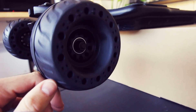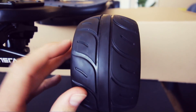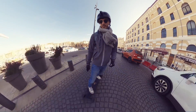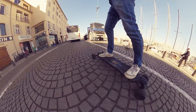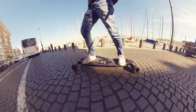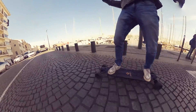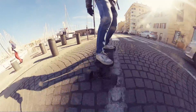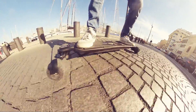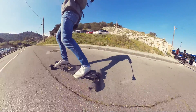The Black Carve 2 comes with 115mm rubber wheels already mounted. These airless wheels are really comfortable on every road, from rough to perfect ones — you definitely won't feel annoying vibration, even on cobblestone. I'd only been using the 120mm cloud wheels before. They are really soft and reduce vibrations, but they have a disadvantage: they drain your battery. At 70A hardness they are super soft, so great for comfort but not optimal for range.